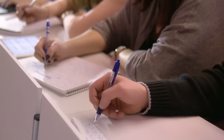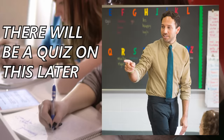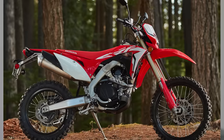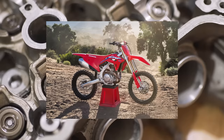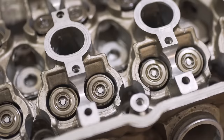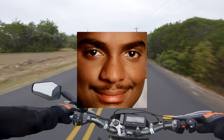I'm going to say this again slowly so you can take notes — are you ready? You should only convert a Supermoto if you are racing it. Why? Because conversions are a gigantic pain in the butt. Most people just go for the 450 because they're spec sheet warriors who don't understand just how much work 450s are. The Honda CRF450R says to adjust the valves every 15 hours or 6 races. If you don't do that, the bike will perform worse and worse until you cook a valve or the bike won't start. There's a cost to all that power.